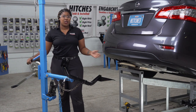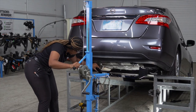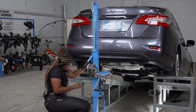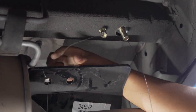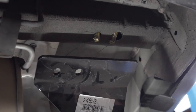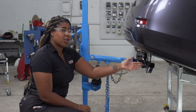Now we're going to line up the hitch with our vehicle using U-Haul's exclusive hitch jack. When bringing the hitch in place, we're going to angle it over the exhaust and line it up with the two holes on the driver's side. With the hitch lined up, we're now going to take our fish wire and thread it through the holes on the hitch so we don't push these bolts back into the frame. So now we're just going to raise our hitch up and flush with the tow loop.